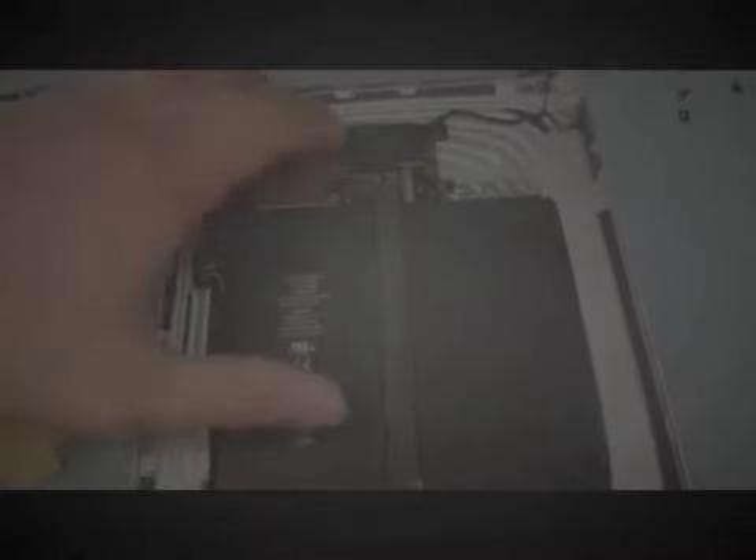The digitizer in the frame has a piece of plastic covering the top of it, so we're going to take that off and then place the LCD — after getting all the dust off of it — right down on top. For the camera, there's a heavy-duty tab at the bottom that's got to pull up. There's some sticky stuff around the lens and the LED, but all you have to do is make sure that little hole is cleaned out with no dust, then place the camera back in that slot. Now the screws are back in, the front camera ribbon cable is attached, all the other cables are connected, and the digitizer cable is still taped to the front of the screen. All my pins and brackets are set. All I need to do now is connect the three cables and press the screen down into place and let it clip in around the outside.